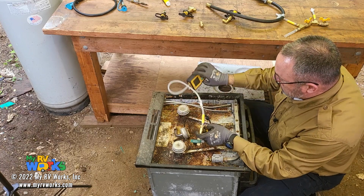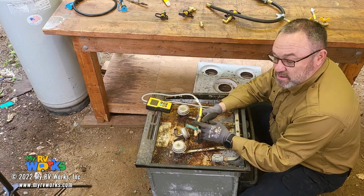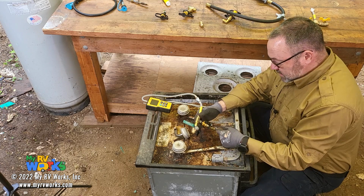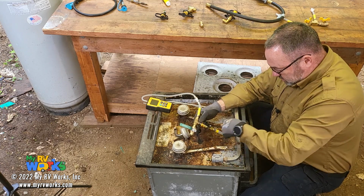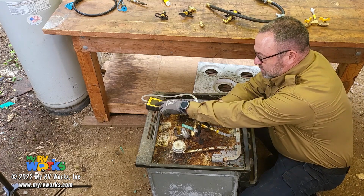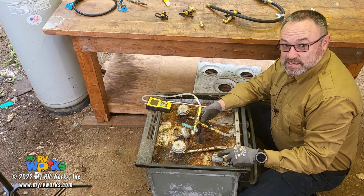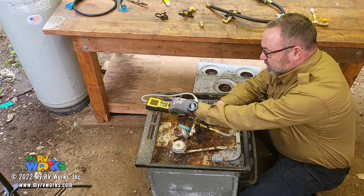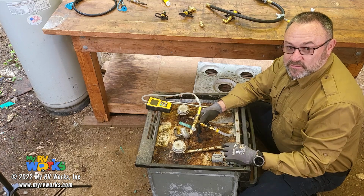Now when you do your time pressure drop test, you are going to bring your pressure down to about 8 inches of water column. And then you're going to close your service valve. The way you do that is you would connect this, the burner gets turned on all the way. You then should get your reading of your LP pressure. Again, note it's going through this additional second regulator. But then you would turn on another burner and you would watch your manometer. When it gets to 8, that's where you turn it off. You time that for 3 minutes.